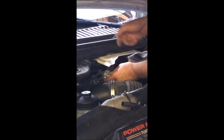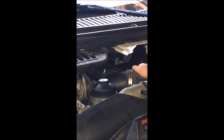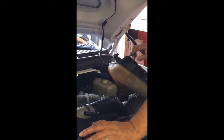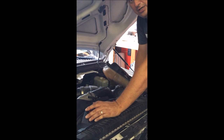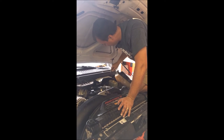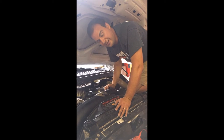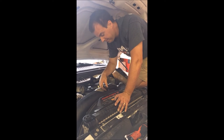Slide it right down through here. Pull up a little bit for clearance. Set down those posts in the front and line everything up. After it's lined up, then and only then go ahead and put it in. Recognize how far the degas bottle can come up out of the way — there is no reason to fight it. As long as those two capillary lines are pointing up, you're not going to make a mess. All three connections are in now — stop. Reconnect the capillary lines before you put the bolts back on, then reconnect the connectors and start the truck. Verify your connections are good. There's no reason to have to get this far again.